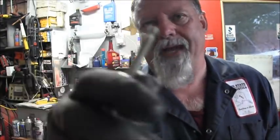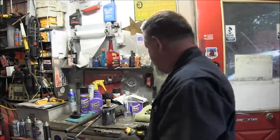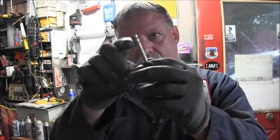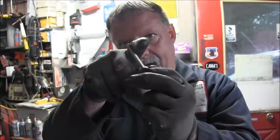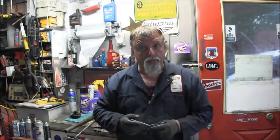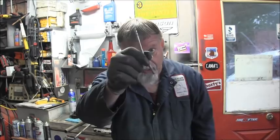And then you don't have to make that 360 degree groove. You only need to make it where the bolt that holds the shift rod, remember, it goes forward like that. So you only need to make it on this back side right there with a Diablo or a little rat tail file or a Dremel tool, that kind of thing. But that's how much of the shift rod you've got to cut off.